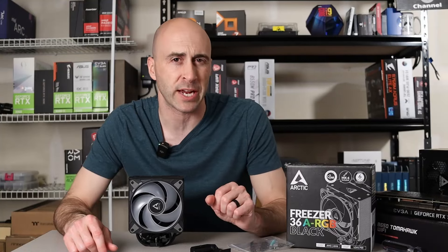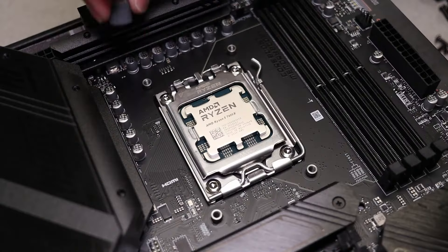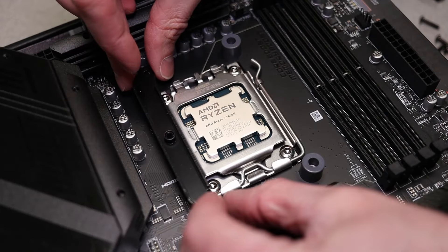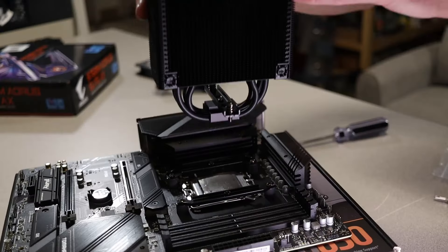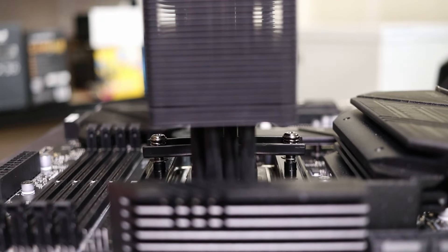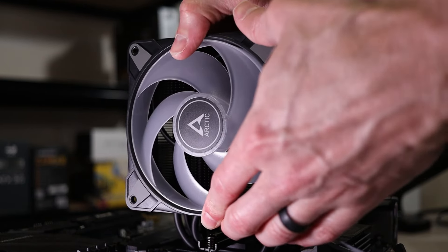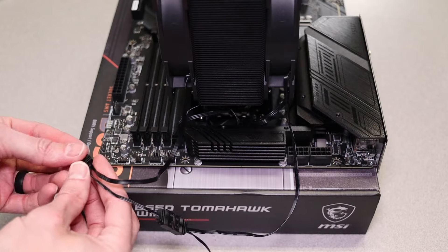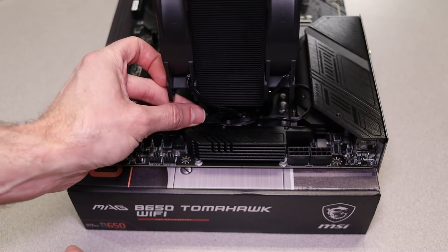AMD installation is a bit more standard. Remove the AMD mounting brackets by loosening the four screws and lifting them away, then place the four gray plastic risers onto the stock AMD backplate. Place the straight metal brackets from the hardware bag angled outward and secure with the four full-thread screws. Lower the cooler onto the motherboard, tighten the captive screws back and forth until they stop, then press each fan onto the quick snaps until they lock. Connect RGB headers to the 5-volt addressable motherboard header and the PWM cables to the CPU fan header, then hide the cables under the cooler.